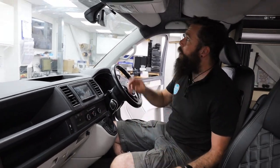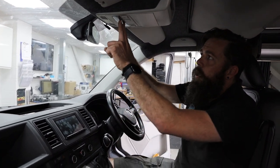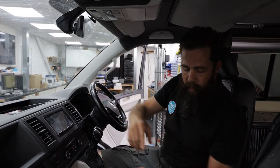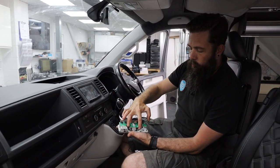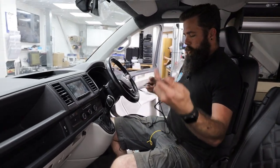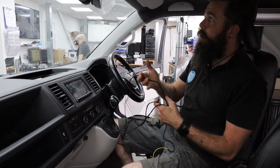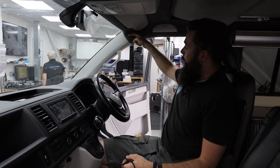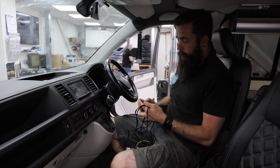What we're going to do is remove the lens from here, which will reveal the two little T20 screws. We'll then unplug everything and remove the microphone, because we need to replace it into whichever side suits your left-hand or right-hand drive setup. We'll then take our loom — which in true Blue Peter fashion we have pre-prepared — and run the yellow fly lead along the roof lining. We'll need to remove the A-pillar and run that cable down to the light switch.